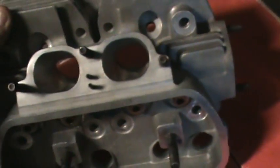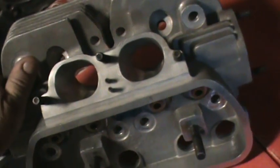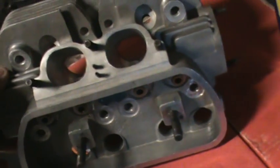Finally got almost all the parts for the 2110 here. Got the crank laid out, the sump, cam, cam gears, studs. Here's our cylinder heads — about done porting these, they're ready to go. So a 2110 with some fire-breathing heads on it should run pretty good.